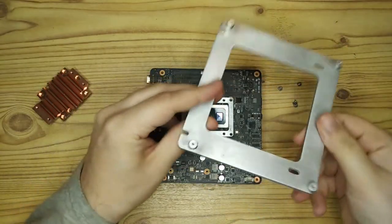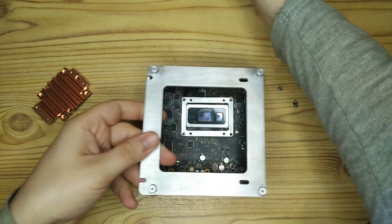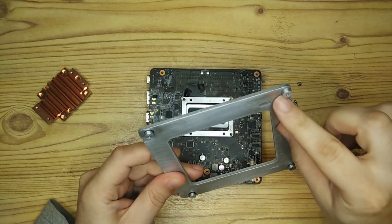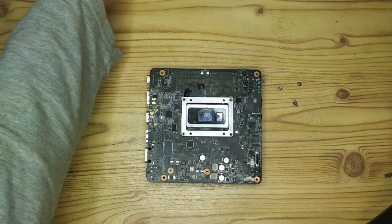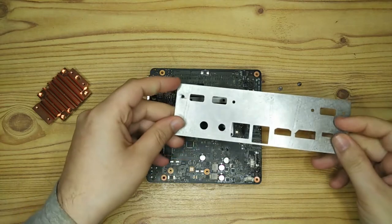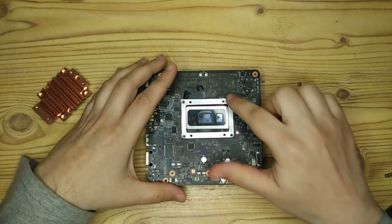So this is the final base plate adapter, and we added some little standoffs to it. If you're going to attempt this kind of thing, I don't recommend you build the standoffs into the motherboard adapter like I've done, because it actually works out quite expensive unless you find a cheaper way to do it. The way we did it, with these little push-through plugs that are tapped, worked out quite expensive to do.